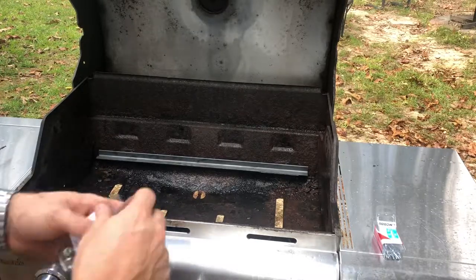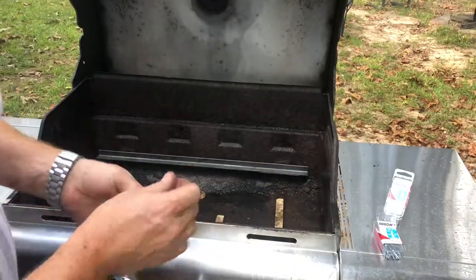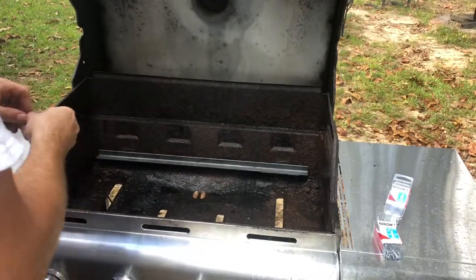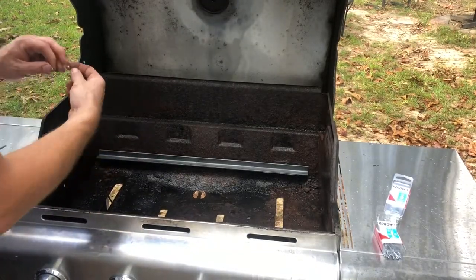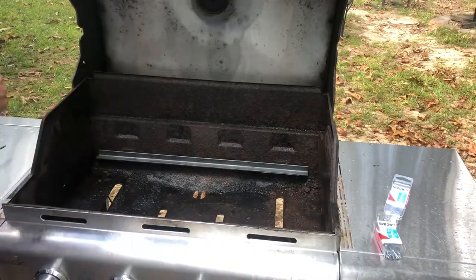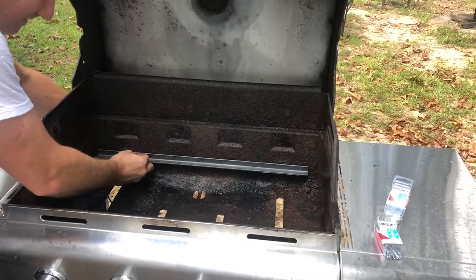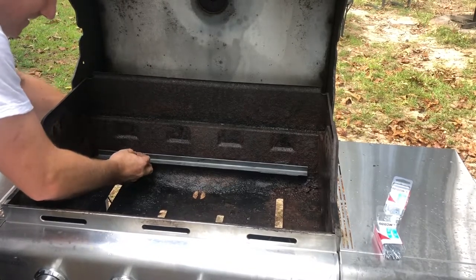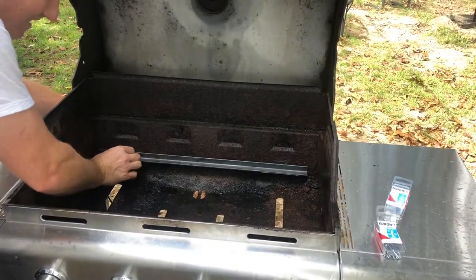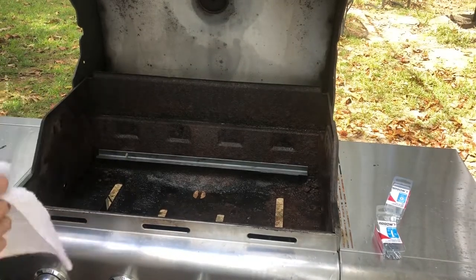And what you need on the other side of the rivet to hold it really good, these have to be steel rivets. You cannot use aluminum. You gotta have a little washer for the other side. And so what we'll do is, because this side will be flush and flat, and this side will have a dip, we'll come through this side like this. Just like that. Put that right there. And so that way all that's on the interior side. Yeah, that'll be fine.